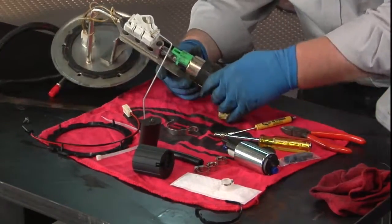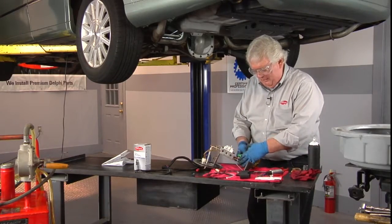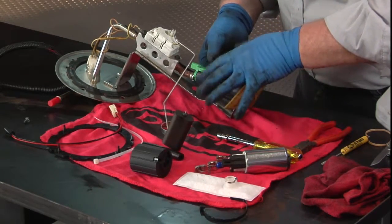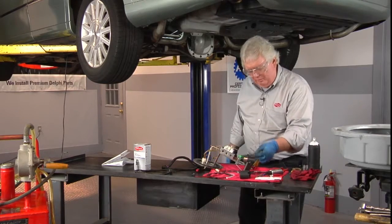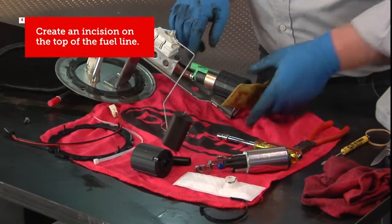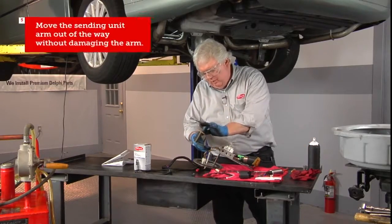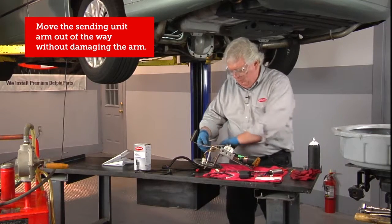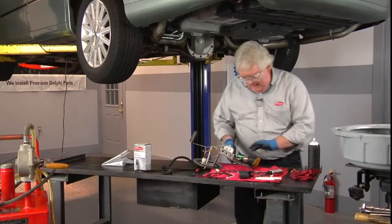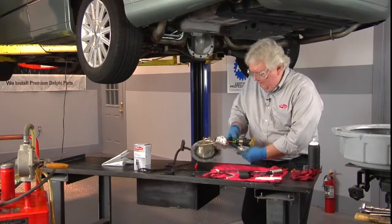The main fuel feed line has a permanent hose clamp — one that's been squeezed once. The head of that hose clamp came off a little bit, it's loose but not prying off. Good news is the Delphi kit came with a new replacement hose and a couple of worm drive hose clamps. So we're going to cut the top off since we have the new hose. I want to be careful with my sending unit arm and float, so a little tech tip: use a simple rubber band or piece of harness to hold it out of the way. Now I can tilt this up and get better access to the hose.